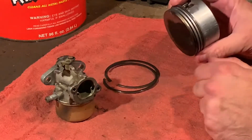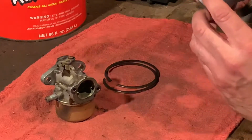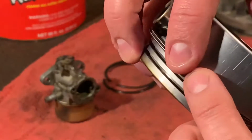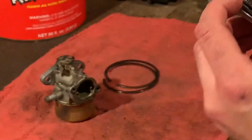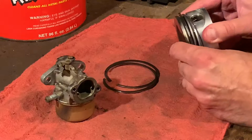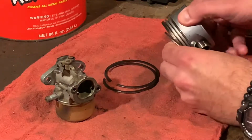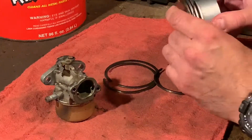You just do that. Oil control ring. I don't know if you can see. I'll show you. A lot of people know. If you don't, there's a spring in there. It's the same kind of deal. We're going to expand it, we're going to remove it, and it's going to come off. Like that. And then we have this spring in here.